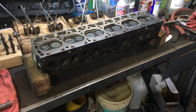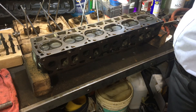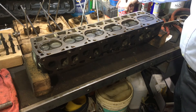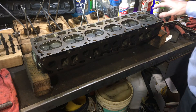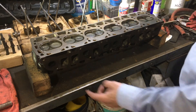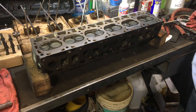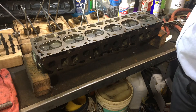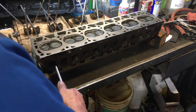This is the head that has been lapped. We've used a real fine solvent — in this case Berryman's Chem Tool, which is a great substance to put in gas tanks to get rid of water and ethanol. We filled each cylinder with liquid, and we're going to blow shop air pressure into each one of the ports and see if we get bubbles around the valve. If there are no bubbles, these valves are sealed and good enough to go. We know that a lot of these were leaking before too.